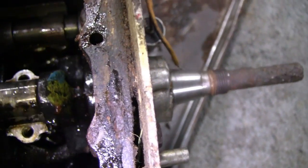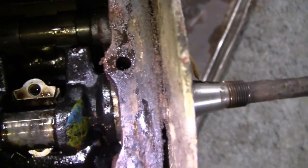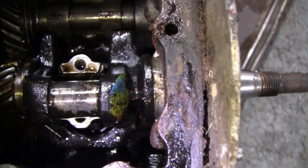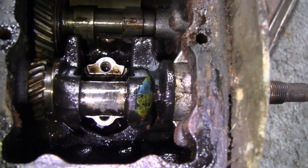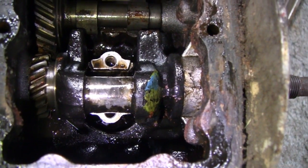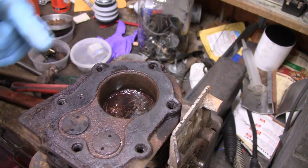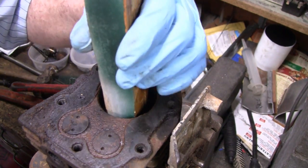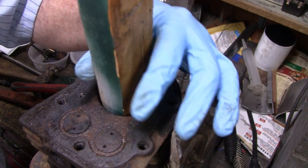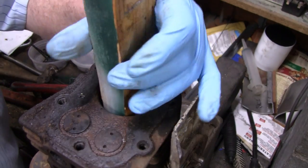As it sits now with the connecting rod in the way, I can't get the crank or the cam out, so it's not like I can shoot the piston out through the bottom. I'm gonna put it back up in the vise again and try beating it with a hammer and see if we get any movement out of it. I had oil on the bottom and the top again. If this don't move, we'll bring it over to the press and get a little movement — I've got about an inch of movement I can get out of it.